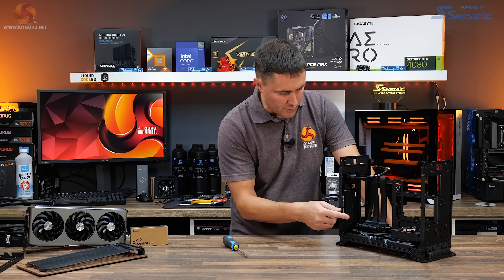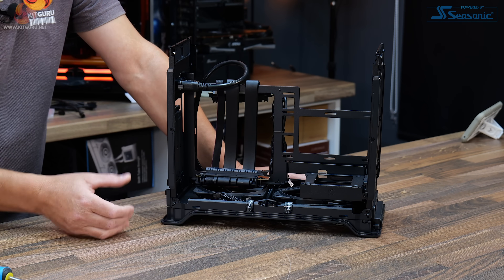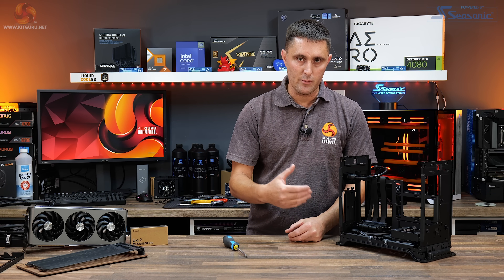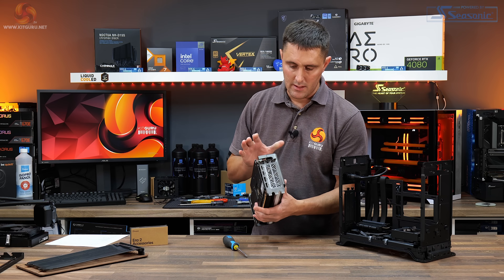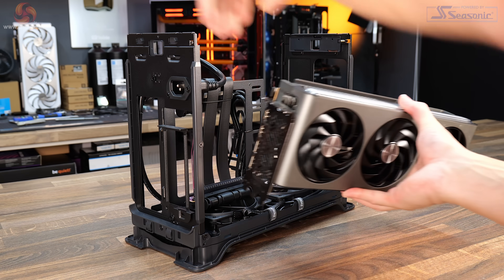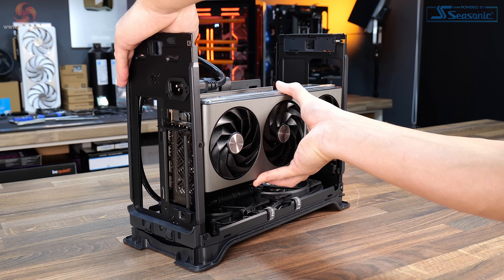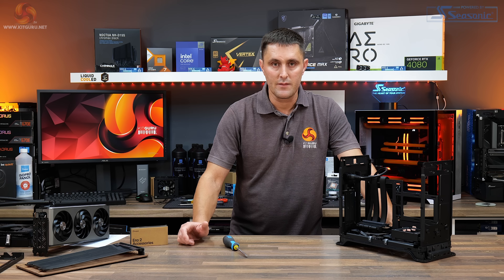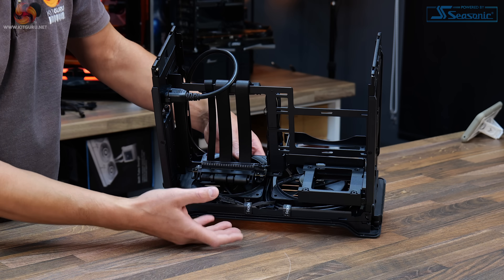Sliding all the way back to position three reduces the maximum CPU cooler height to 48mm tall. The case comes with a PCIe Gen 4 riser cable pre-installed, so you just slot the graphics card into position on that side. During testing, the 326mm length limit proved more restrictive than the width, since slightly wider cards can still fit. This Sapphire Radeon RX 7900 XTX Nitro+ is more like a three-and-a-half to four-slot card and does actually fit with a bit of persuasion. However, anything over 326mm in length rules out quite a few cards, including many of the larger RTX 4080, 4090, RX 7900 XT, and 7900 XTX variants.